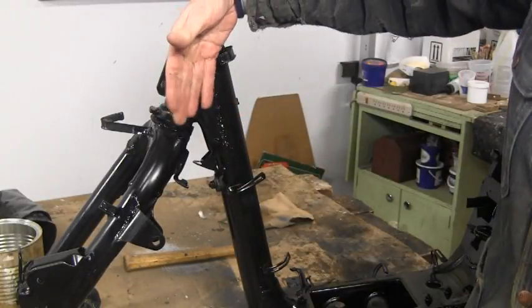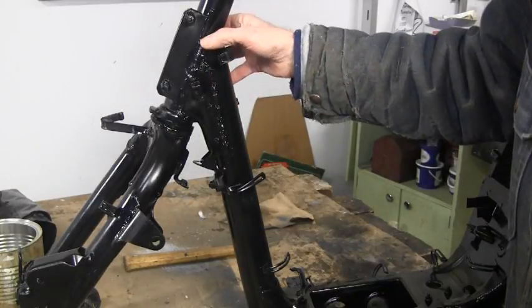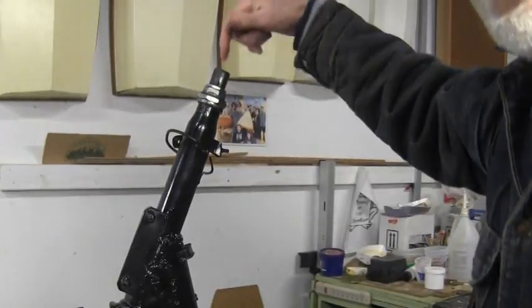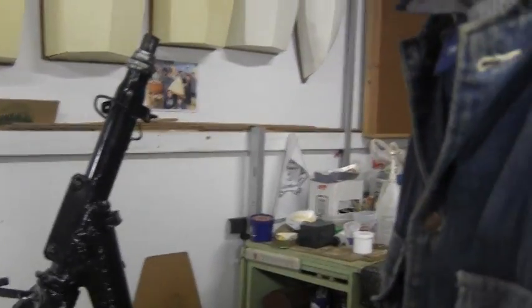So I took my Dremel and cut all the welds along here and up around the neck, all the way around. Then I had a rod that fit perfectly through the inside of the head, and a spacer ring that fit the larger diameter down to the bottom. I set up a grid on the floor — drew a straight line — then set the frame of the scoot over it, found the center of the frame, leveled it, and hung a bunch of plumb bobs over various points on the frame to line it up on the line I'd drawn.